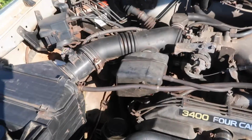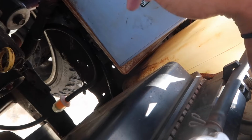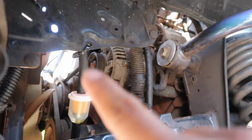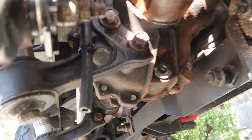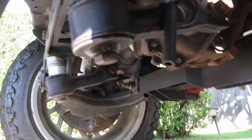And inside the engine bay, sorry, I never continued cleaning it, but we're going to get to that in a bit. But yeah, you guys see how the line comes up and goes up and over and around and back down. The reason why I did it like that, where it comes up and goes back down, is because if you just leave it straight up, there's a possibility of water going inside if water ever gets in here. So it pretty much goes up and then down, coming down here. This guy, and it's been dry, so that's a good sign. No leaks so far, or anymore.